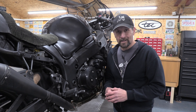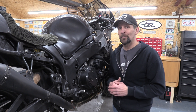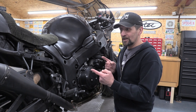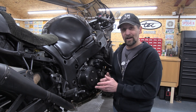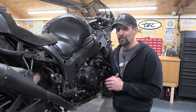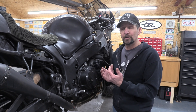Good morning, welcome back and welcome to the new shop. The very first job we do on a bike here is the fabled clutch mod on a Hayabusa. This is a generation one Hayabusa and they came with a slipper clutch mechanism. At higher mileages those mechanisms wear along with everything else on the bike and they start playing up and causing problems. There are a couple of ways you can modify that mechanism to stop it playing up and stabilize it so it acts like a normal clutch.